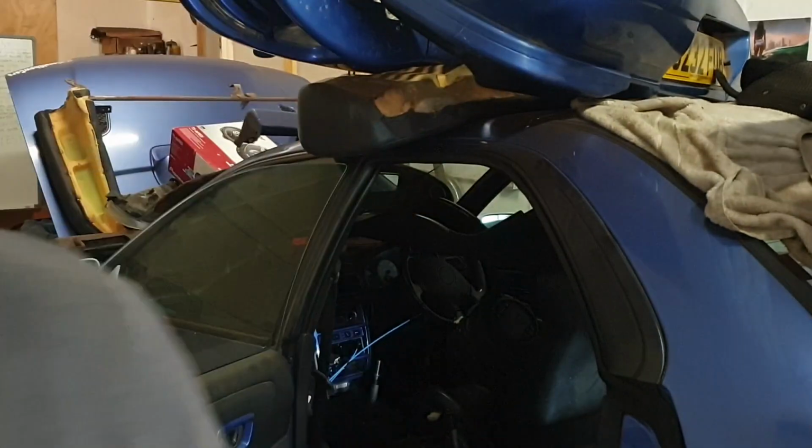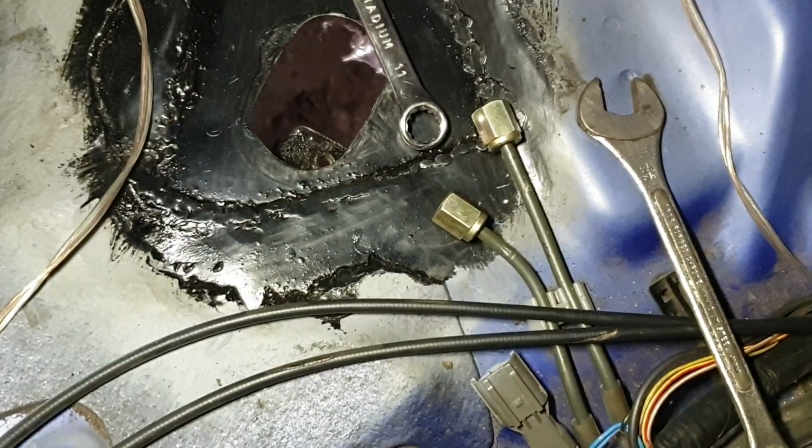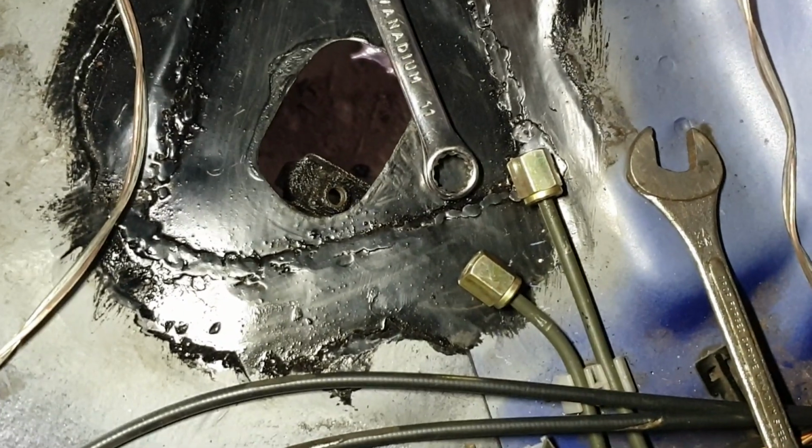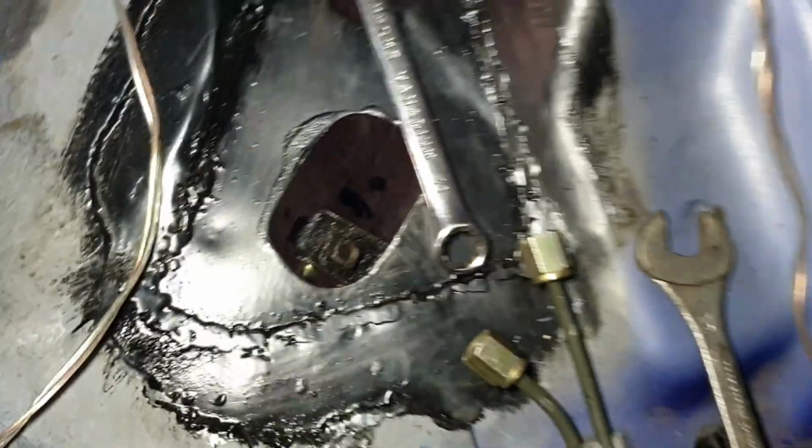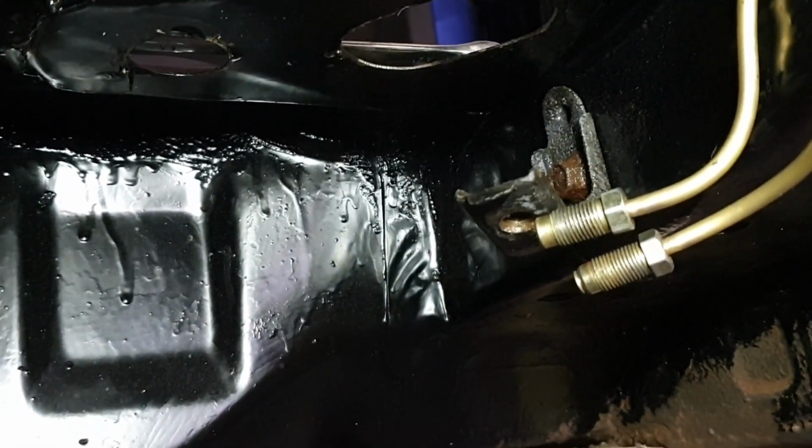If you remember back, we ripped all the brake lines out because they were all crumbling. That means we had to obviously replace all the brake lines, missing footage. The brake line from that union to each caliper has been done. Now we need to link that up to what's left inside the car. So, this is where the problem lies. Follow me. This is what I've managed to make. We've flared up two ends and made two female unions ready to take two male ends. So they'll pass through this hole and mate up to these, using two link pipes and attaching to this bracket.